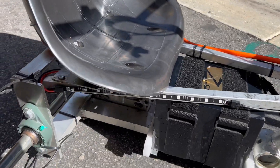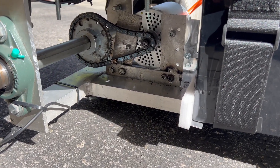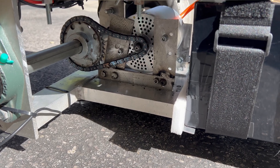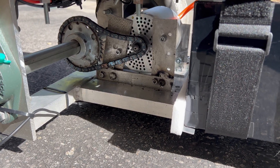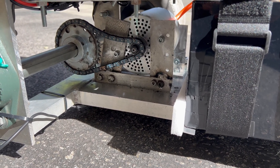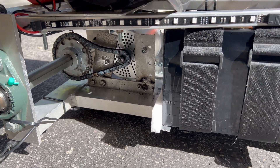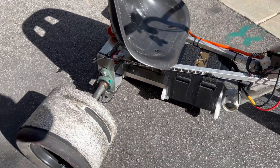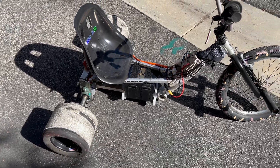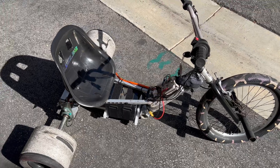The last thing I had to change with the setup was the gearing. I used to run the 35 chain and I went back down to the stock T8F chain — 11 tooth motor sprocket and 38 tooth axle sprocket. It has zero overheating issues now, it's a lot more controllable during drifts, and it's just overall so much better now.